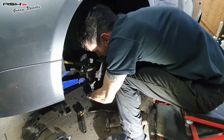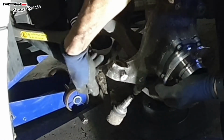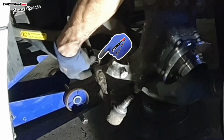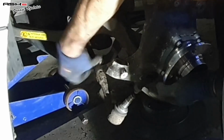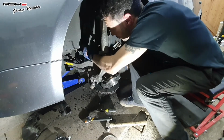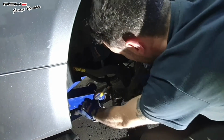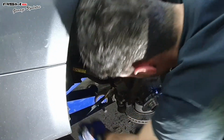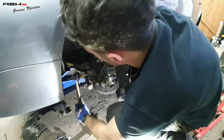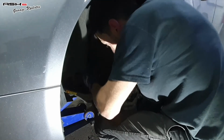So there is an interference type collar cup that essentially helps lock the threads on the track rod end in, and it's a little extended cup washer with the tightening nut there. It is a 15 on the inner tie rod, and I'm going to use the little flat points on here to not do anything. I hate adjustable spanners. They are Satan.